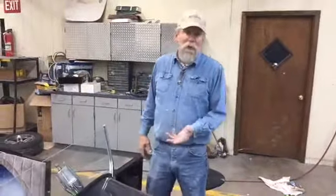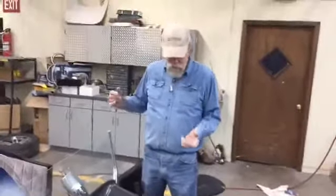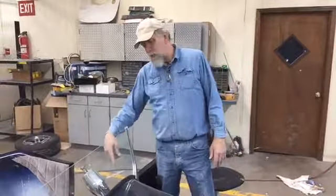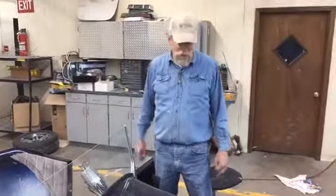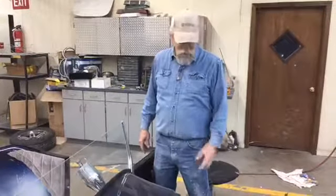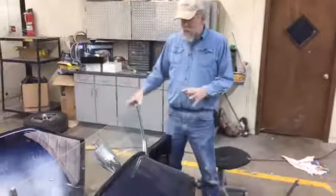So if you've got the body from us with the insert, you can just use your frame as the jig, put the body on where it goes. Holes will already be in the floor for dropping the bolts through into your body mounts. It'll be on the frame. There'll just be a couple tabs, four tabs under there. Put them in, there you go.